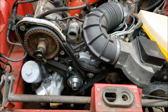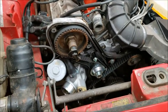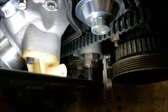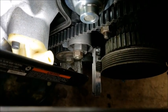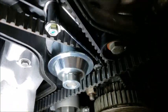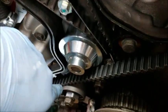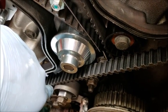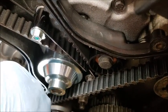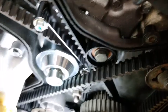Before I start cranking it by hand, I forgot I need to put the idler pulley on. You'll notice I've got a feeler gauge there — there needs to be a half-millimeter gap between the belt and the pulley, and this is supposed to be just barely touching the belt, bowing out 0.1 millimeters. As you can see it can still spin, so I just need to tighten it down.